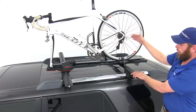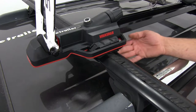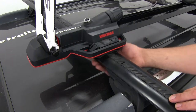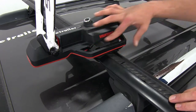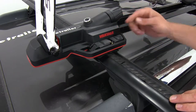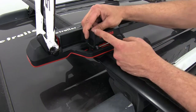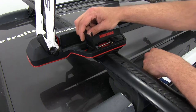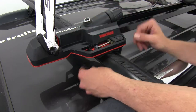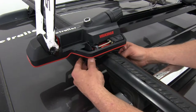The rack is held in place using three stainless steel straps that are rubber coated, so we're not going to have to worry about rusting and corrosion, and that rubber coating is also going to protect our bars. It uses a nice system for how it attaches — you can see this cover, we just slide that back. Once that's back, that allows us to tilt up on the lever, and that cover slides right into there to hold it in the down position. At that point we'll just remove the two round studs from the indents and you'll see how that slides right down and through.